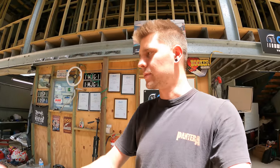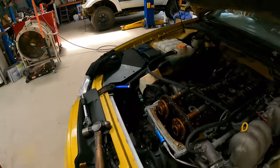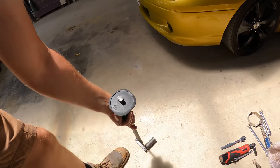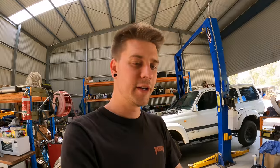I wanted to film this one more in depth - I've actually got the GoPro for this one, and Rex is going to be more involved so I can show more of the process. Basically it goes like this: pull your intake off, pull your rocker cover off, pull your balancer off. We have a power bar - you hook this on and use a hammer. It pretty much eliminates the requirement for moving the radiator. Once we get the thermo fans out, there's plenty of room to knock the balancer off. Then we use a special balancer puller designed for LSs and Fords.